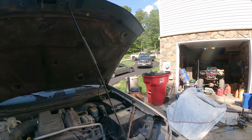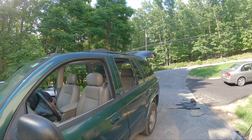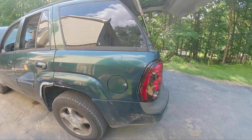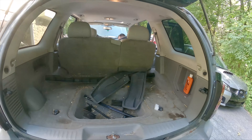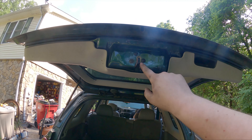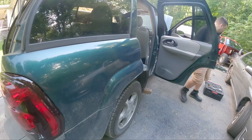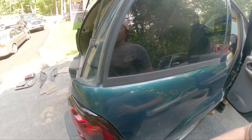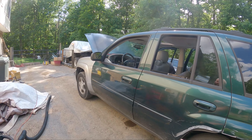It's some general suspension problems, a little bit of rust on the car, but honestly for how many miles are on the car it's not bad at all. Got some paint scrape here — might try to do a paint-match rattle can down the road. Back tires look good, shocks look good, a little dirty in here but not bad. We have a little bit of rusting here but it's kind of odd — there's rust on that but if you come up here it's not that bad, so we'll see where it's coming from. There's also a squeak coming from here, so I don't know if maybe the hub or wheel bearing is bad on this wheel or if it's a CV issue. We'll have to jack it up and see if any of the CV joints are torn. That's pretty much the extent of the problems we know about at the moment.